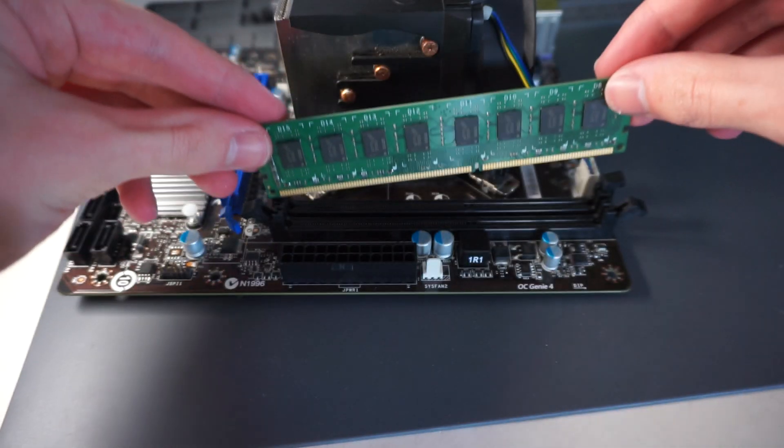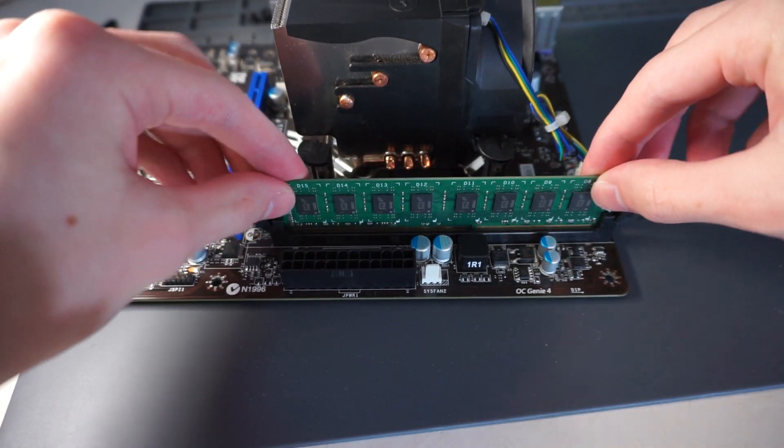The first thing I'd upgrade with this PC — and what I'd recommend if you're in a similar situation — is the memory. I'd recommend upgrading from 8GB to 16GB, and a big reason for that is it's currently running in single channel, which isn't ideal as you may only be saturating one of the memory channels. If you add another 8GB stick it will be a lot better — it will help with frame times, reduce stuttering, and will probably bump up your average FPS as well.